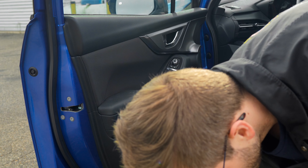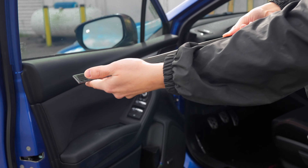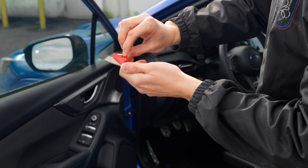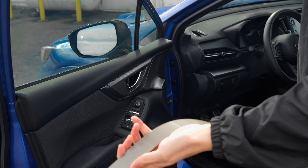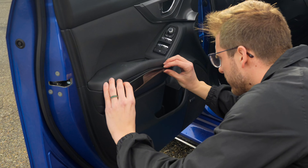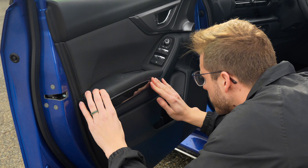Once that primer is dried, you can now apply the carbon fiber trim. Peel off the red backing and position it exactly where you want to apply the part. If necessary, feel free to peel the part back up if it's been misplaced and push it back down. Make sure there's a full seal between the carbon fiber part and where you are mounting it.